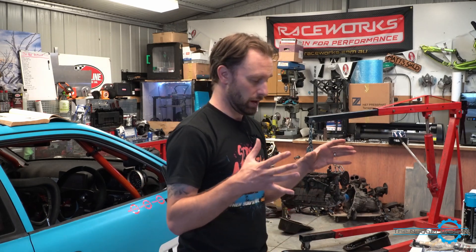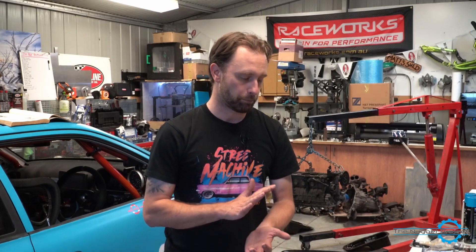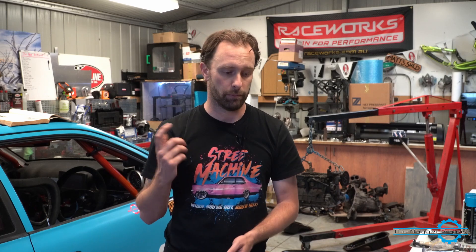We'll use the VRS kit — all new seals and gaskets — and make the best engine I can in the time I've got. I don't need to do everything before Saturday, when old mate is coming over to engine-seal it. I basically need to do everything in the head: the cams have to go in, the head has to go on and be sealed. I've got to measure up everything for the gasket, do any lapping, and sort the chain guide — all before he arrives. The center cap and sump work I can do after he's left.